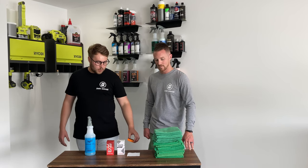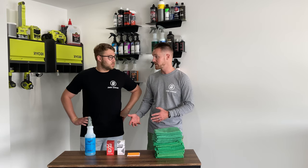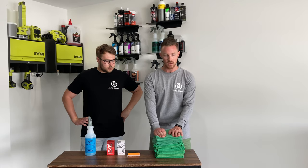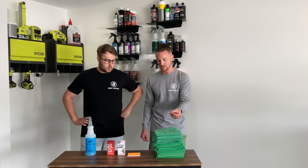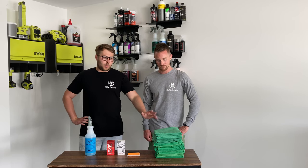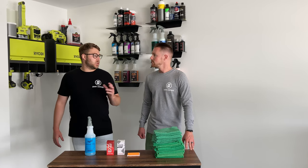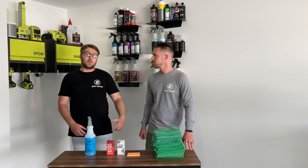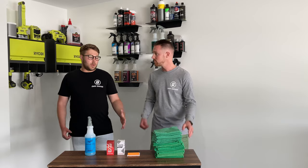At the end of the ceramic coating stage, the coating towels are no longer good for the car — they become rags, because bits of ceramic coating will have hardened in them and could scratch paint. We used 25 Rag Company coating removal towels, the same low-pile towels used for the glass coating step. 25 was definitely enough, and now you've got rags for the next couple of years. They're about $1–$1.20 each, so get 25 to 30. The entire ceramic coating process, including curing time, took us the better part of two and a half days.